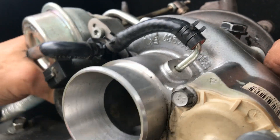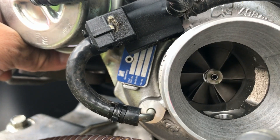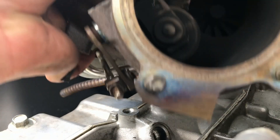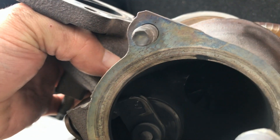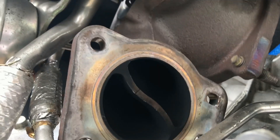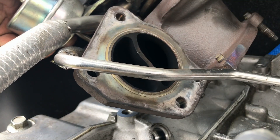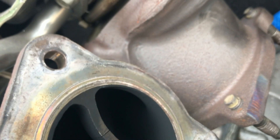What we want to do is inspect it, make sure everything works. Doesn't seem to be any kind of shaft play in there. This turbine seems to be working out. Like I said, it's only got 23,000 kilometers on it. Oh, I think I spotted something here — what do we have here? We have a crack right in the turbo housing. That is replaceable — pretty sure you can find that. So there's one problem.